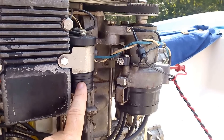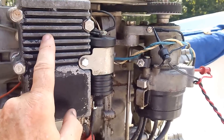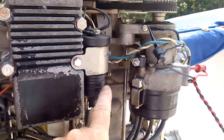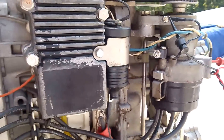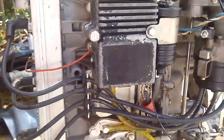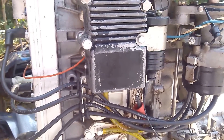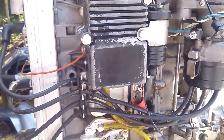The big car coils with the oil fill can tolerate that much more so than these little plastic ones can. And the multiple packs — those small coils on engines that have one coil per plug — ground those things. Don't leave them free. You'll also keep from hurting yourself.